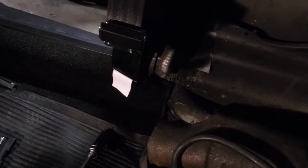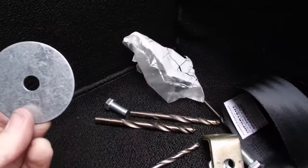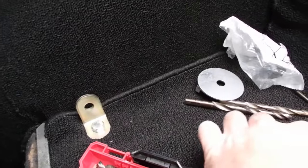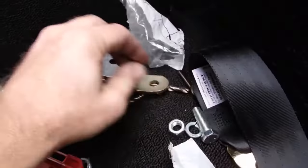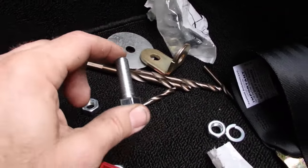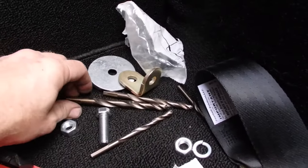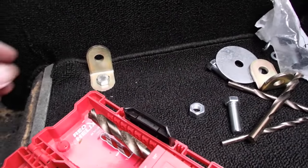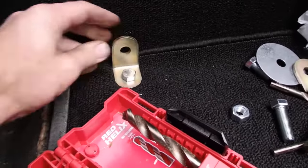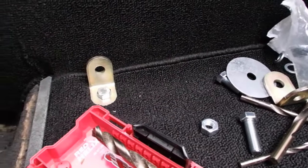I'm moving to the back seat — that's going to be a bit more complicated. I've got the bracket in, and on the underside there are these mounting pieces. I took the longer bolt so it gave a little extra purchase for the nut, and I used thread locker, stepping up to about a seven-sixteenths hole. It is solid — the car moves before that thing moves. I'm pleased with that.